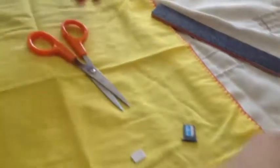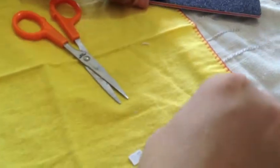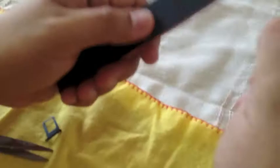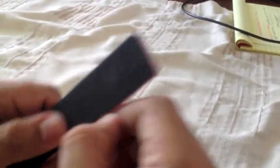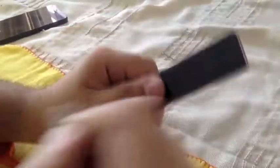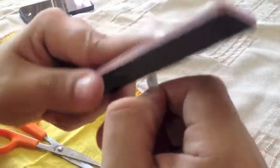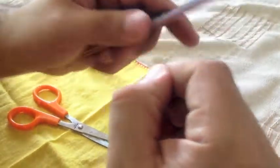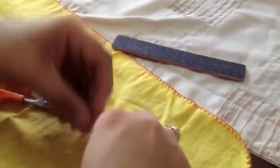After trimming the width, we need to take a little off the top of the SIM card to make it thinner. Grab the SIM card on one of the edges and file it down like this — try to be even. Try not to go too deep because you might hit the metallic plate and damage your SIM card. Just trim it down a little bit to make it thinner so it fits the SIM card tray. There are better ways to do this procedure, but if you're in a situation without all the tools most tutorials require, this should work fine.